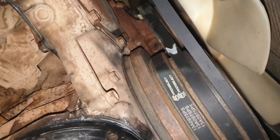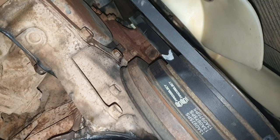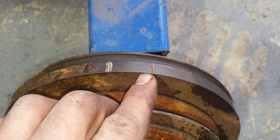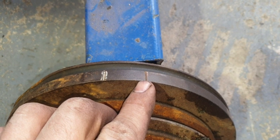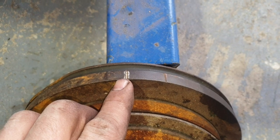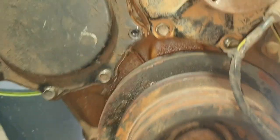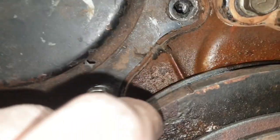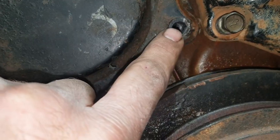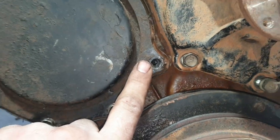It's a bit hard to show you exactly where the mark is, but I've got a spare engine I'll show you. That first mark you see on the harmonic balancer is to set up your fuel pump — it's the second mark you want for top dead centre. The timing mark on the engine is just there, roughly straight under that bolt on the front of the fuel pump cover.